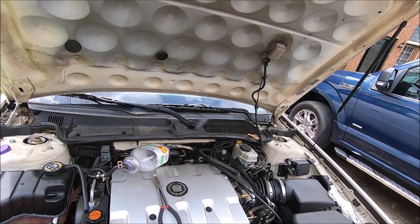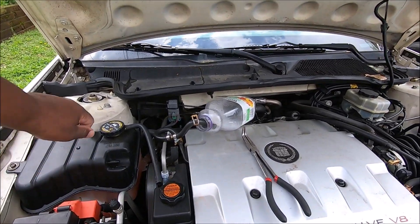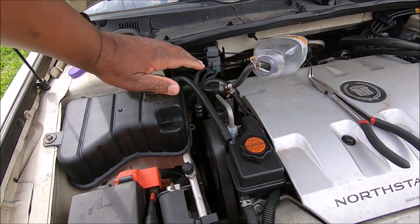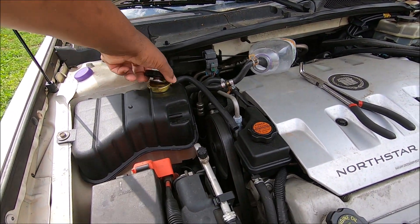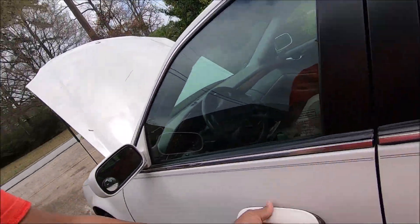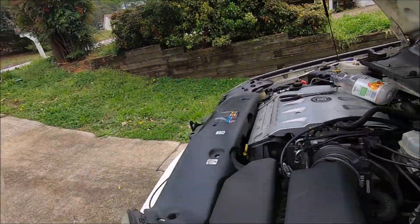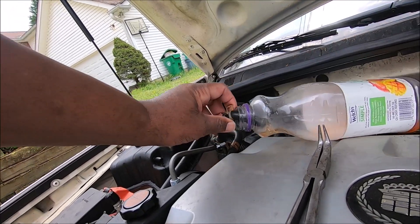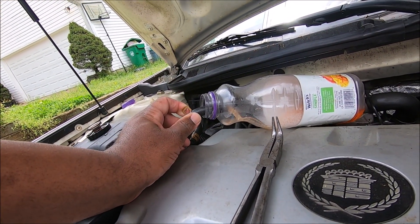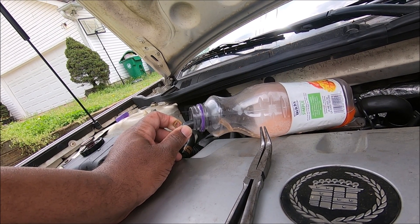Some people say step on the gas, but you don't want the engine to heat up very quickly — you want to keep the engine cool. You might also want to open this up. Notice how water is coming out — every time you see a little sud, that whiteness, that is air.